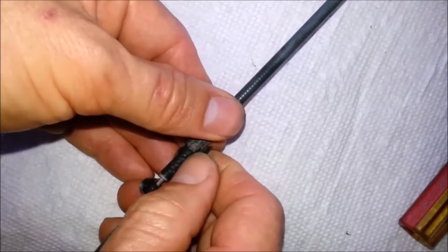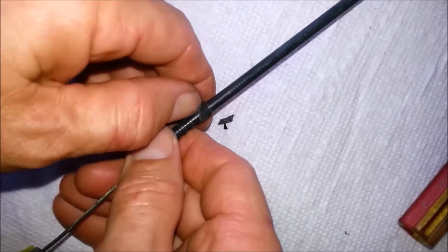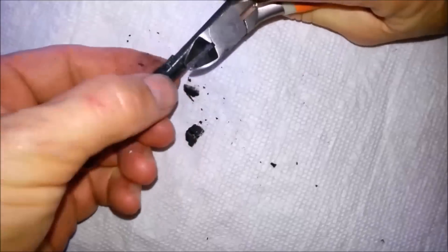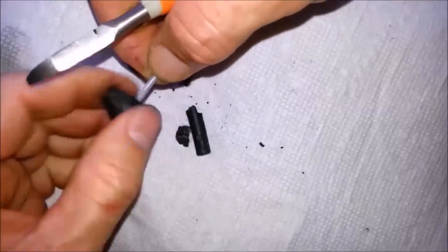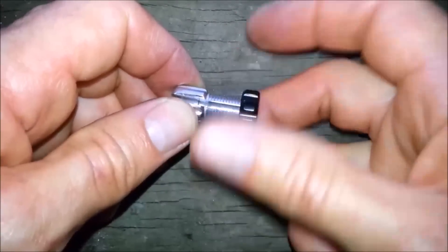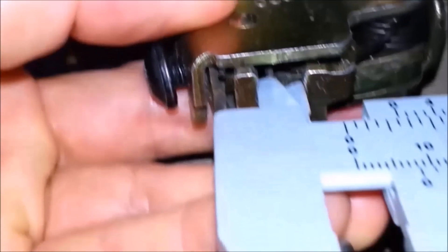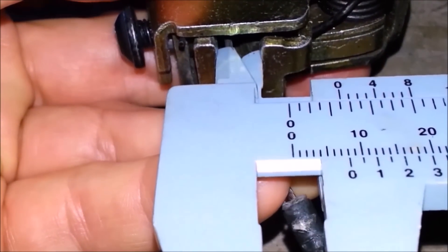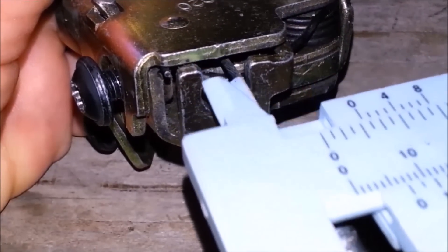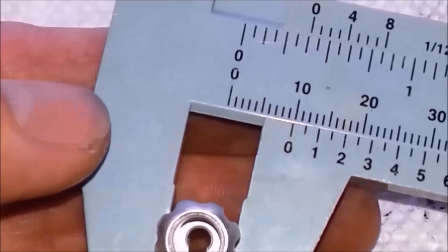Remove the old housing end from both cable ends. The ends on this cable were so brittle I used my fingers to remove the old material, though sometimes it requires a little more effort. I'm going to remove the jam nut because I don't need it to repair either of these cables. Measure the size of the slot for the attachment point — all four cable ends on this truck are about 8–9mm, and the narrow part of the slot is about a millimeter thinner. I'm using the 10mm brake adjusters, so I'll have to file the threads off a small section to get the adjuster to fit correctly.